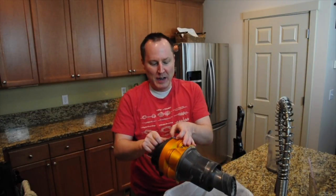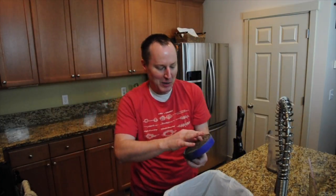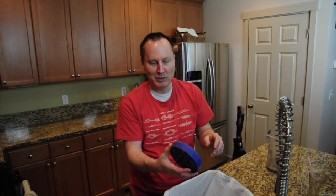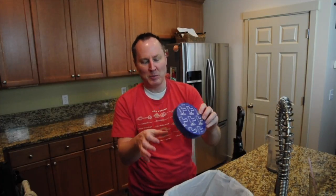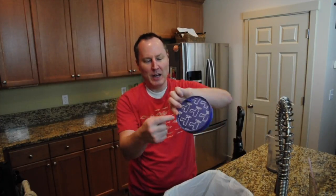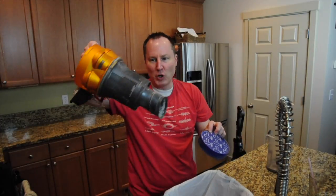The one thing you want to clean out is the top filter — and you can see there's some hair in there. I joke that if I took all the hair from the vacuum and from brushes I could make a little Ewok outfit for Halloween. Anyway, this is the filter. Other vacuums have a cone filter. If it has this little water emblem on it, it means you can wash it — run it underwater.